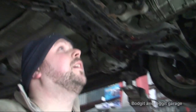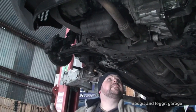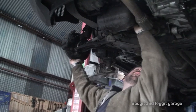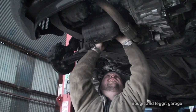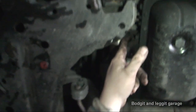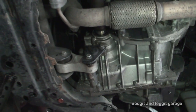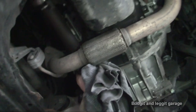What I need to do now is get the drive shaft back in. I'm going to hold this end out, hold the drive shaft — you might not be able to see but you'll see what I'm doing — and then just literally push the drive shaft back in to place. Be careful not to hit the bearing as you go in. We've got to get this bearing inside this cup here — we're not fully in yet but we're resting on it, and then that will allow that to go in. Another good thing to do is give the shaft a good wipe so you're not putting any crap inside the gearbox. Put a rag on it and spin the wheel just to wipe it.